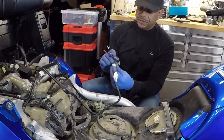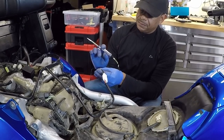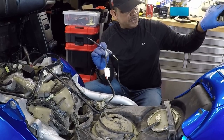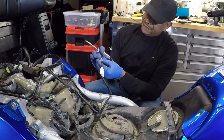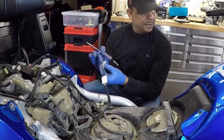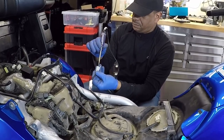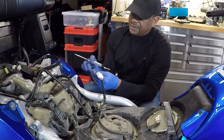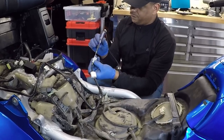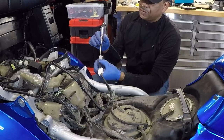Your brown should light up when I touch it — correct. Now I'm going to go left turn. Yellow is left turn — when I touch the yellow it should flash. Okay, correct. Now right turn — right turn is green, when I touch the green it should flash. That's correct. Mark, we're going to verify that the brakes are working — when you touch the brake it should light up. Let it off, touch it again, let it off. Okay, now we can cut the Goldwing.